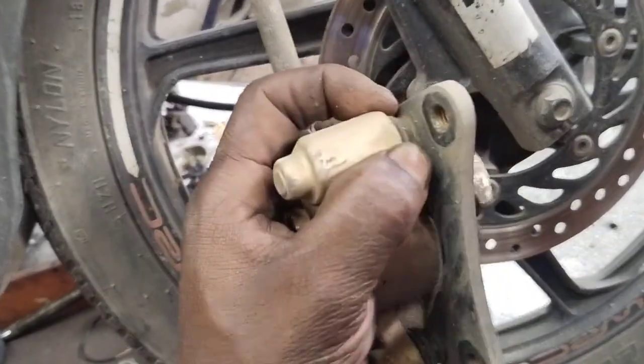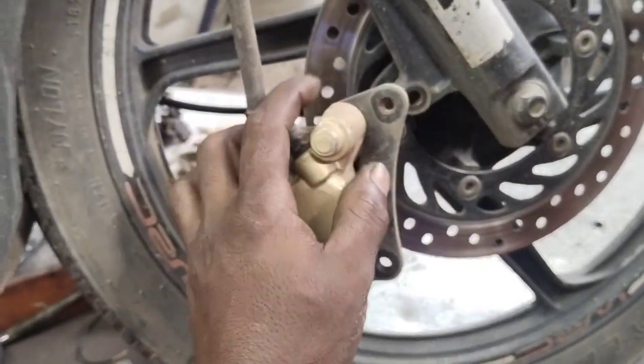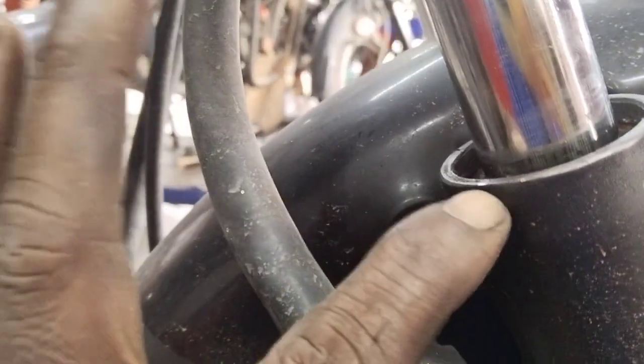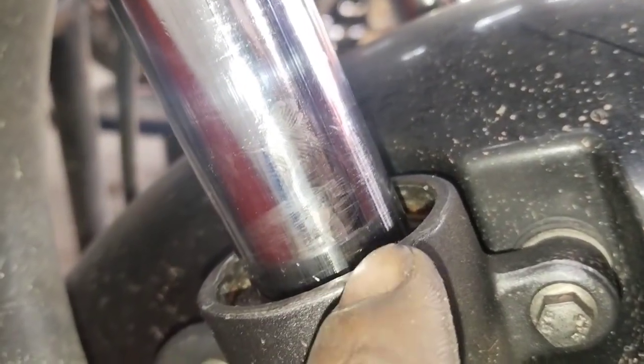We will check the disc brake. We will not have grease or reset the disc. We will not have success with the front fork because there is a leak on this side. We have to check out the dust seal, and check the pipe for the fork — there are more scratches on the pipe.